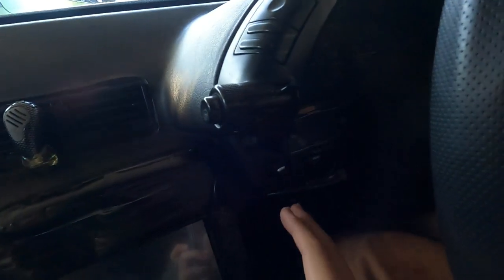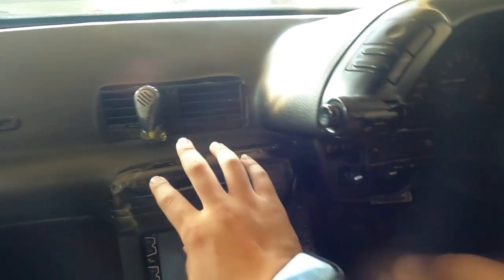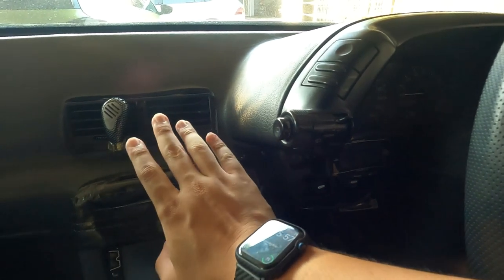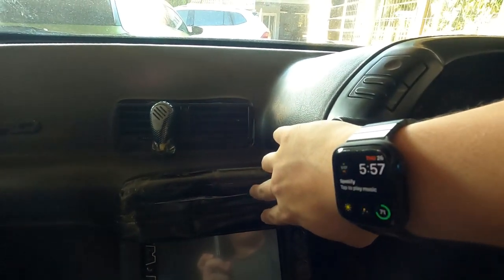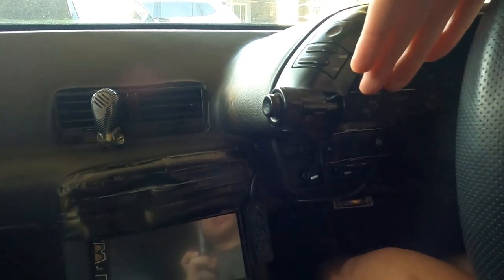So what I've fixed — I've actually done the air con. You can see right here I do have some air con switches. Yes, there's supposed to be a panel here — it's still covered with duct tape but it will be replaced in the future. I decided to remove the digital air con controls and go with some analog ones and rewire the whole system, because the digital cluster is high maintenance, costs a lot, and is getting pretty hard to find. I also replaced the compressor with one that supports the new gas, since the previous one was from the RB25 Neo. The filter is kind of stuck and I'm still trying to find a replacement filter for the air con.